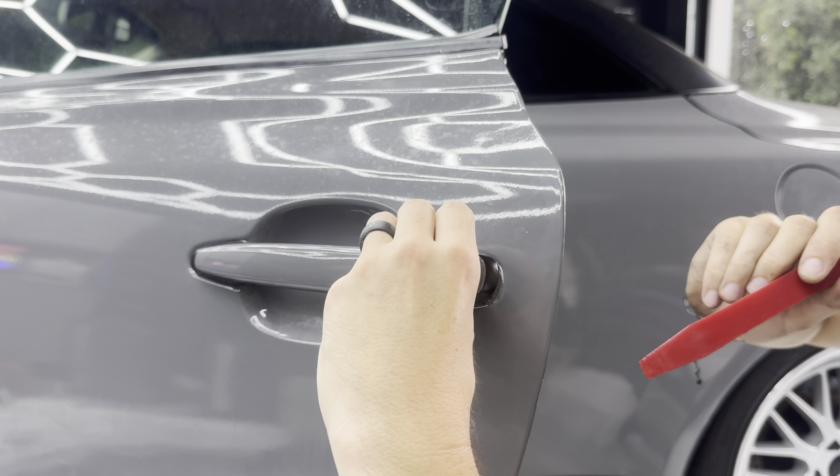We're also going to have to take off this entire trunk liner to get to the spoiler — it's just a bunch of these little clip things. Once the trunk liner is off, there are two bolts to remove for the spoiler. The hardest part is getting the adhesive removed. Remove the two bolts and then carefully remove the seal. I gently started lifting up the side, took a razor blade, and sliced all that adhesive, because if you just pull it up, you're going to crack the spoiler.